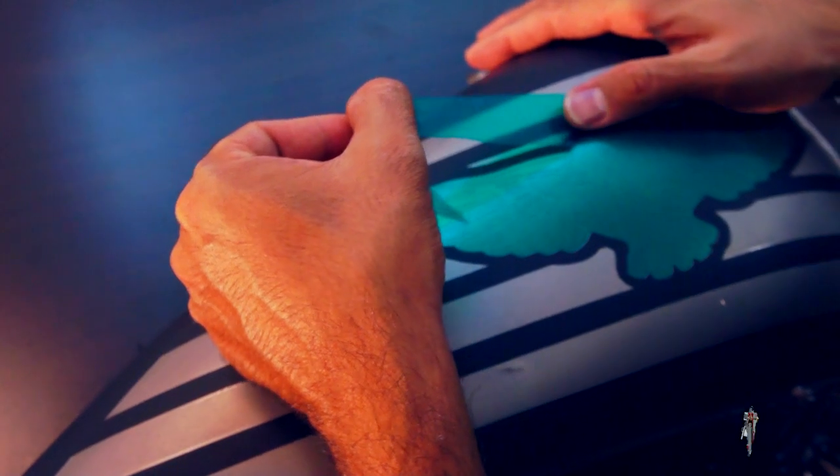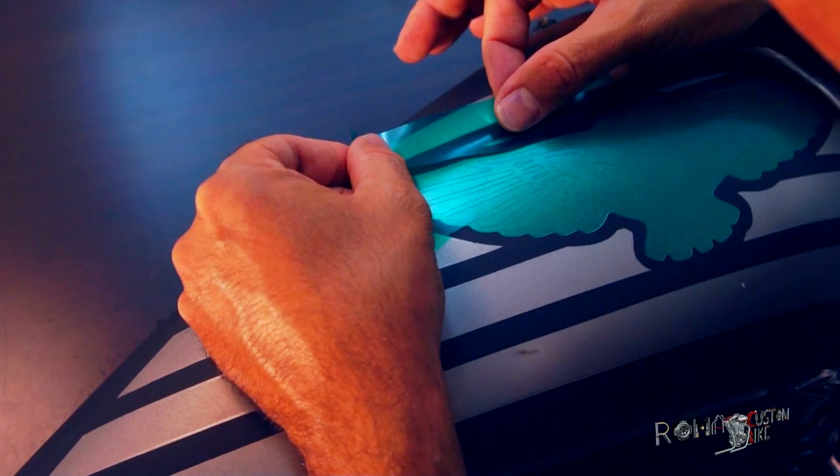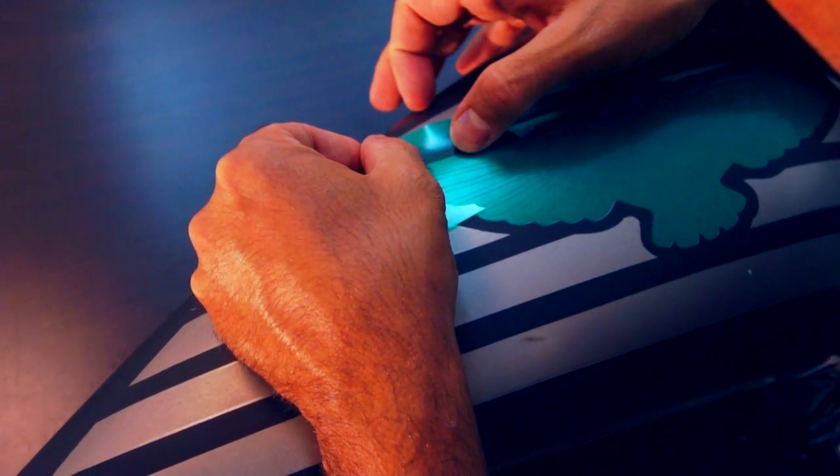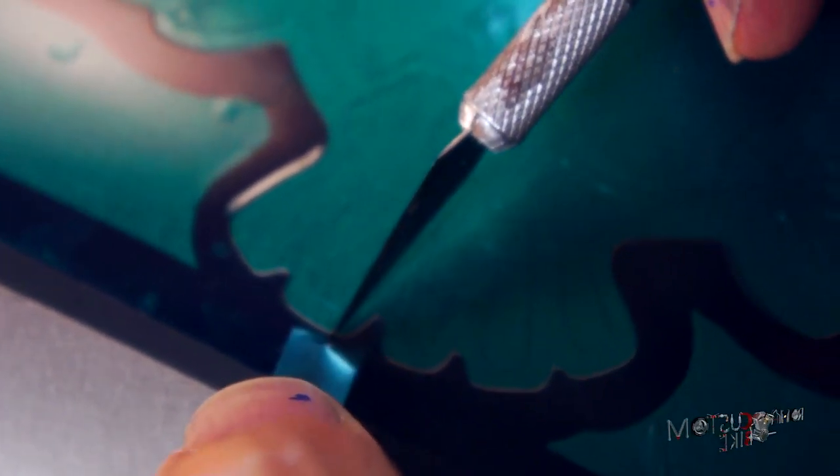And now that Christian is done with the logo stencil, he tackles the outside area. And you might wonder, why didn't he leave it all together? It'd be done by now, right? Well, the reason is that this way, by splitting the sheet in 4 parts, he's able to leave a few microns of space around the shape to make sure to cover a little bit of black with the red paint. This way he's sure that no silver will pop through between the red and the black. By doing this, it will also have a little space left between the 4 parts as well, but we can fix that with some extra tape.